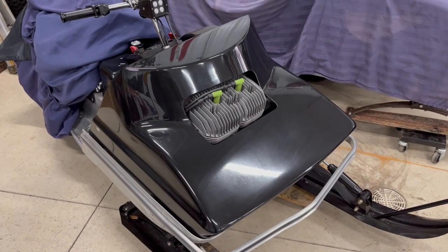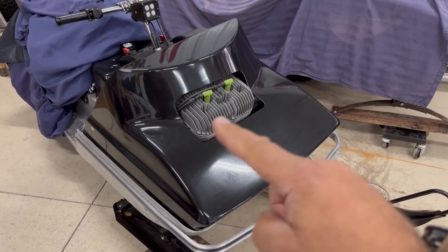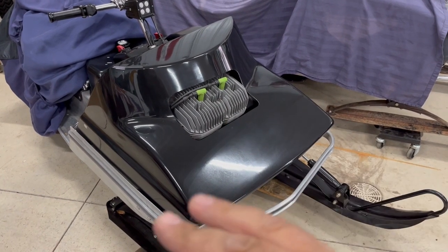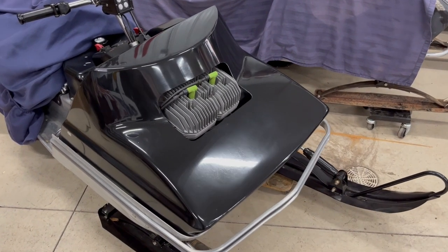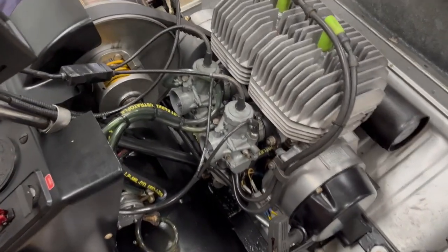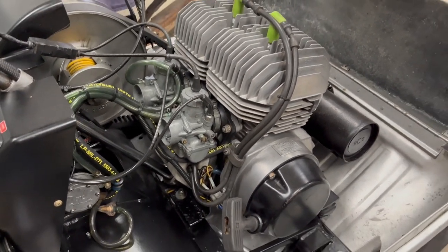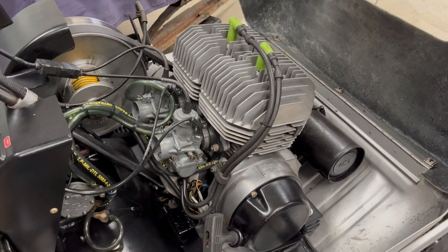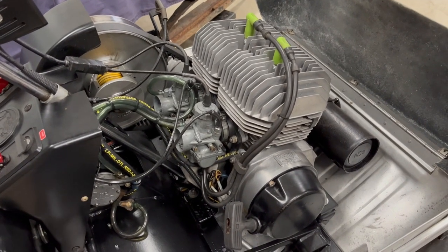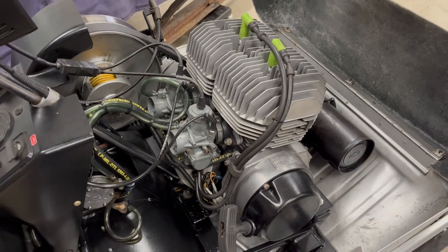So, this is the poster child of why I'm doing this — my 1971 Custom Puma. I used a 1974 CDI 340 Free Air, stock, bone stock, unmodified from an El Tigre. This one has dual VM-34s factory. This engine runs so good. I can let it sit there and idle for 30 minutes, never foul the plug. This thing starts predictably every single time, hot and cold.